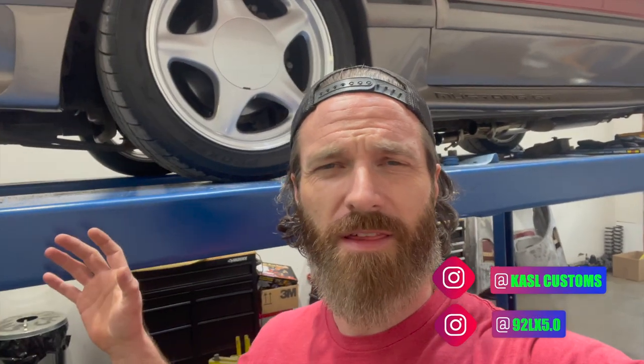A bit of an impromptu video here — I wasn't expecting to do anything along these lines, but I figured I'd bring you guys along for the ride. Maybe this will help the community out. I have a rattle in the '91 vert. Where I get this rattle is sitting on the driveway, emergency brake on, idling away, no foot on the clutch — rev the car up and I get this almost exhaust-shield-style rattle, which obviously can't be it. I've got Magnaflow cat-back, H-pipe, headers — there are no exhaust shields rattling.